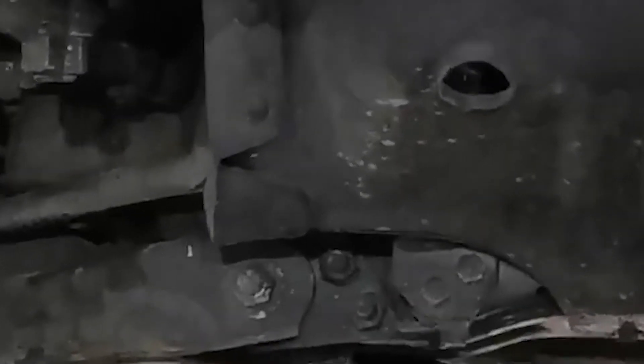Before we lower the vehicle, we'll take a closer look at the drivetrain. As you can see, no oil leaks again — I will point this out, no oil leaks. The rear main seal is nice and dry. The clutch is really solid and grabs early on, with a consistent feel on the clutch pedal. I drove this vehicle for a couple of days and I enjoyed it. The CV joint boots are in excellent condition — inners and outers. The vehicle only has under 10,000 miles. Here's the alternator, and there are just absolutely no signs of oil seepage.